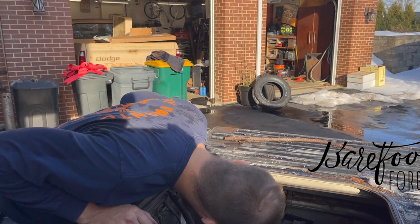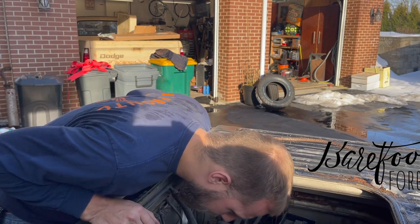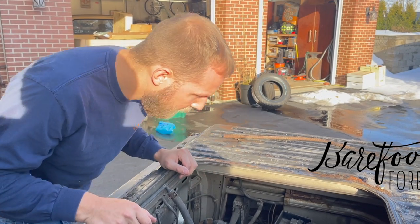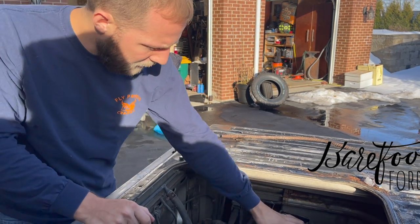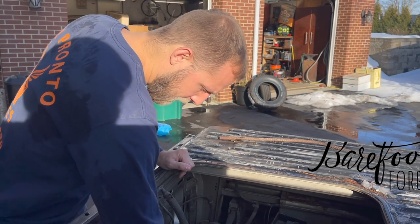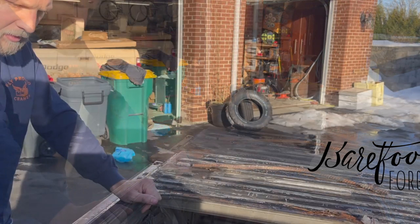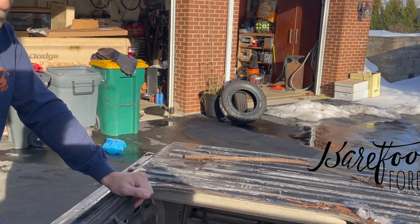That tail light wiring looks hacked. The ECU is back there — it's a 2.1 running a 1.9 ECU, so it's 1.9 fuel injection. It's 112 horsepower, Digi-jet based DJ engine instead of MV.